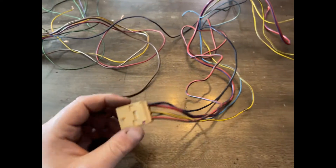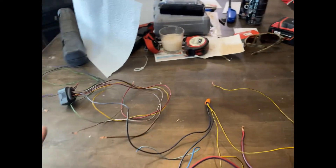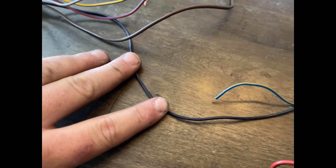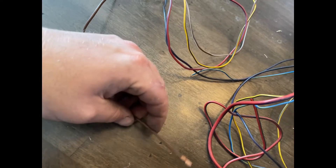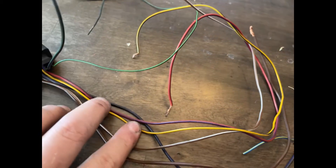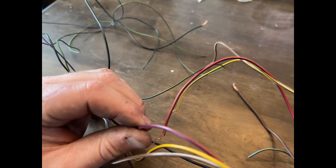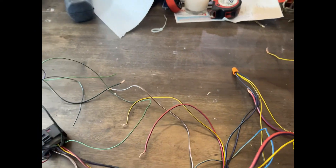Here is the female end of the brown plug, currently semi-connected to the T14 connector which goes to the small-side engine wiring harness — I don't have that out as it's still connected to my engine. From the T14, I'm powering the purple wire. The brown wire is connected to ground — brown is always ground. I'm also connecting the yellow-black wire and a red-purple wire to 12-volt power. So we've got one large ground wire and multiple power connections.